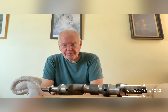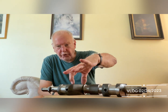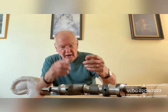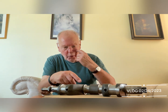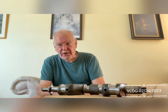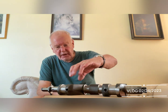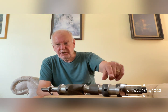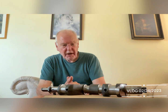The standard Austin 7 crankshaft has two oilways — holes drilled in the cross piece — and they're bolted together, semi-circular underneath, so that they form an oil gallery. The problem with those is that because of the centrifugal force, they tend to fill up with all the sludge, they get blocked, and that causes the bearings to seize at the back and the front as well. So that's not a very clever idea.